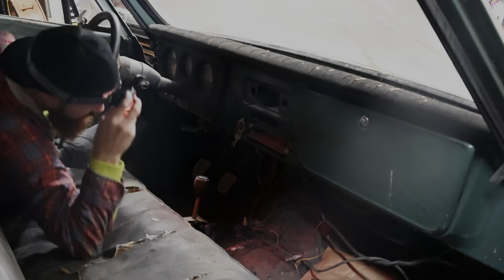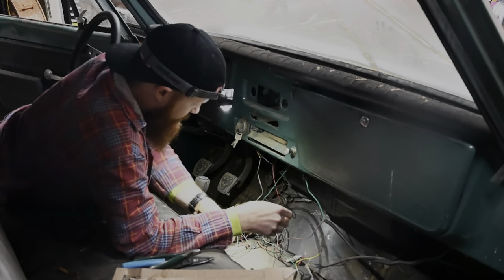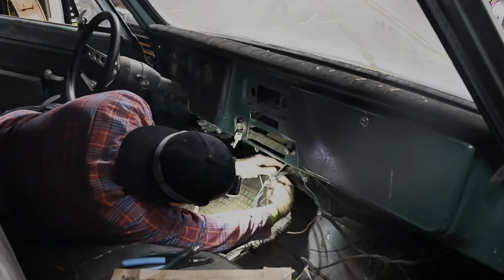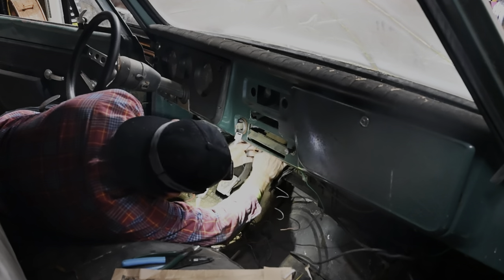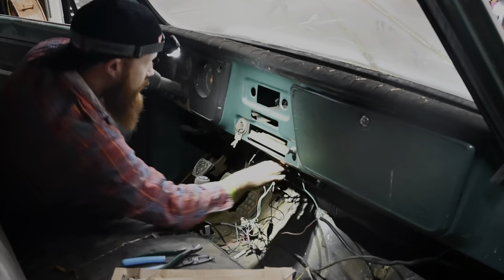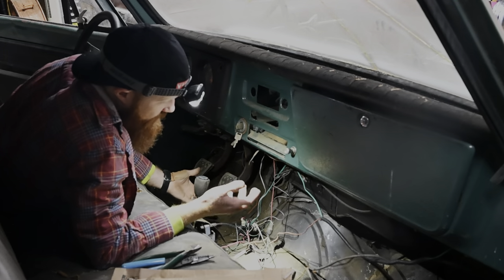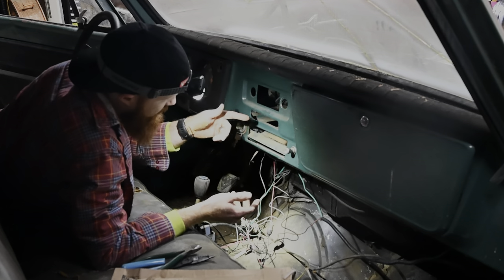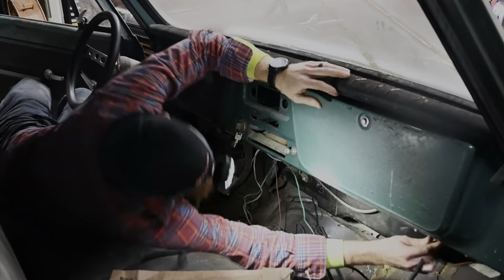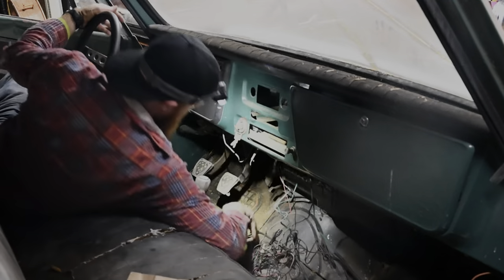Shifting gears a little bit here from our engine bay — I realize this thing has a pretty gnarly looking radio installed. I'm just going to get all this out of the way because it is just kind of a mess right now. I want to figure out what we've got going on coming off the back of our ignition switch, because we're wanting 12-volt power coming off of our ignition switch going up to our HEI distributor. Outside of that, we don't really have to have any power going to the engine currently — we just need the alternator working so we can run this thing long enough to break that camshaft in.